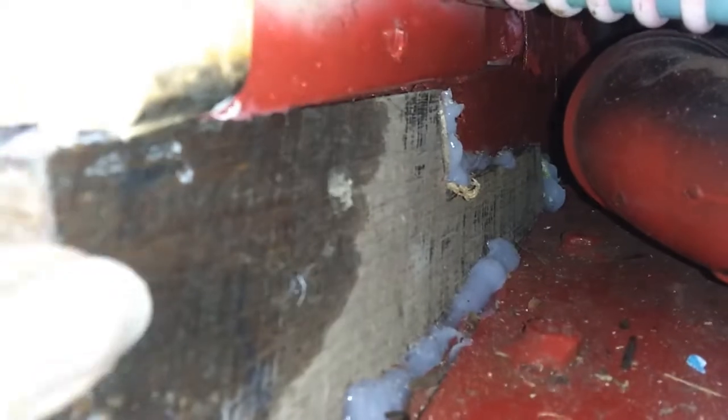You can see I put this piece in here — this piece up in here was rotten, right here, so I replaced it. I'm using silicone where I join two pieces together. This stud that goes all the way down the length of the camper was rotten, so I replaced it this way. This board wedges really tight right underneath the other one — it's not going anywhere because it's interlocked in a zigzag joint between the two boards — and I've got silicone on it.